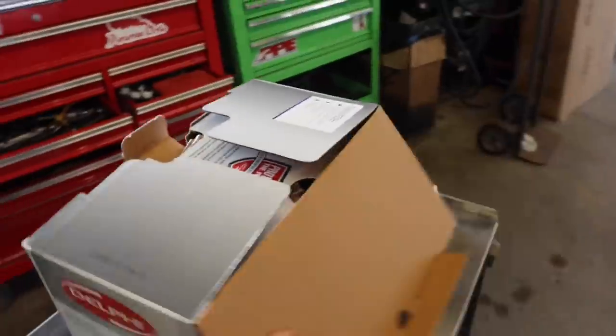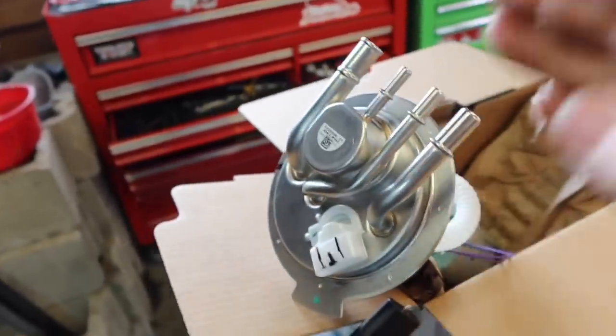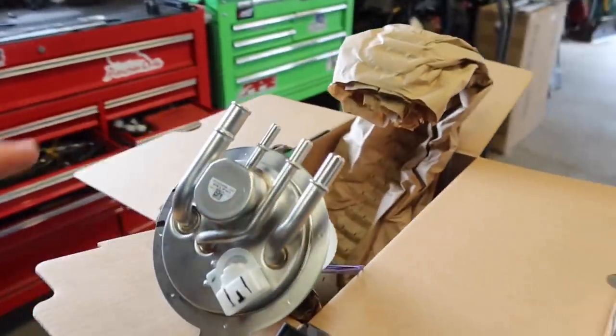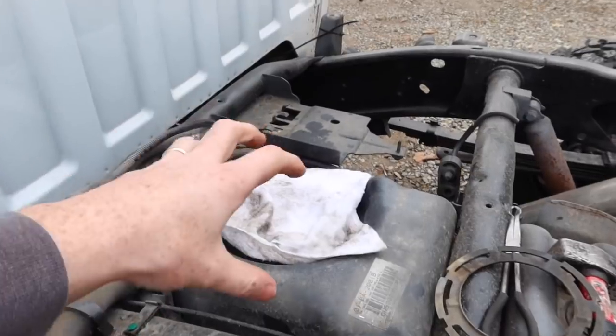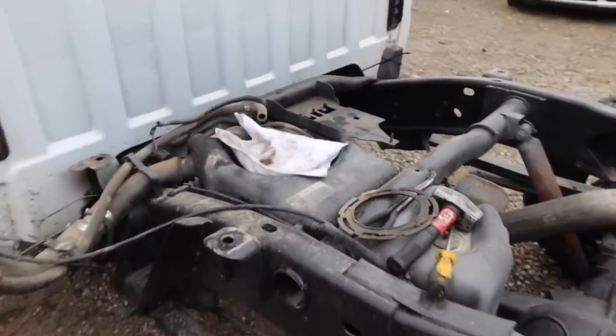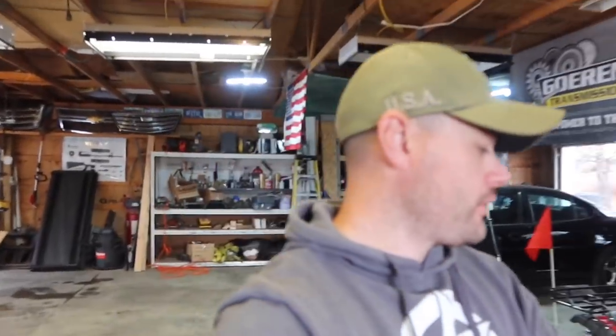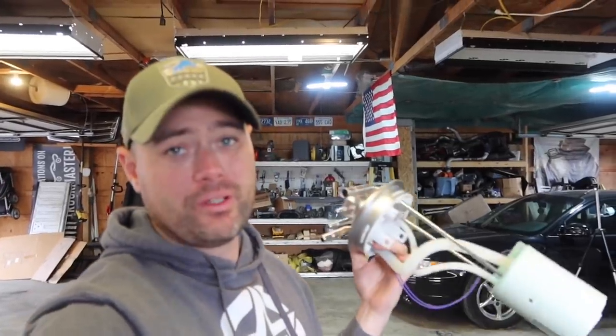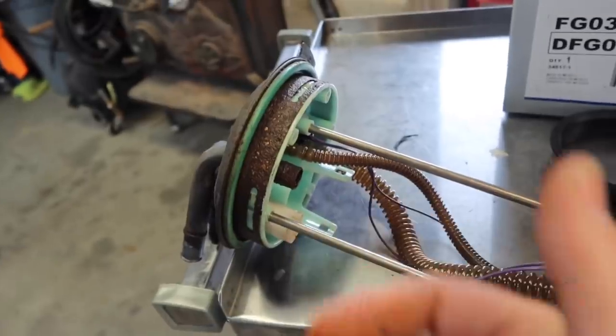This is hours later in the day. So this is a different sending unit — it's my fault, I'm human and I mess up just like everyone else. This right here is the stock sending unit for an LLY Duramax. When I picked up the LB7 sending unit, I suspected it would fit on the LLY or 05 tank, but the circumference of the hole where the sending unit fits is actually a lot larger than the 04. So I went back to the auto parts store and returned it. Now you're probably wondering why I bought a new one instead of reusing the old one — let me show you why. That is disgusting. It's like putting on a dirty pair of underwear — I can't do it.